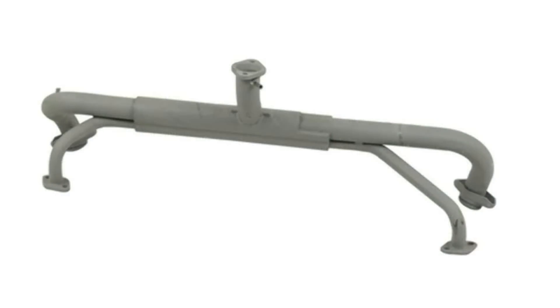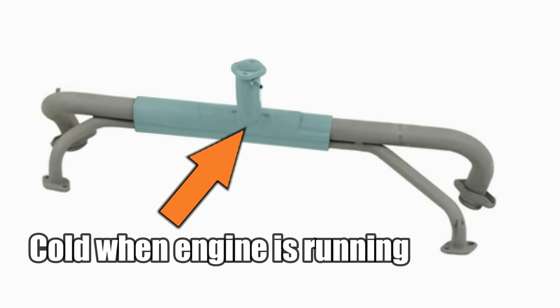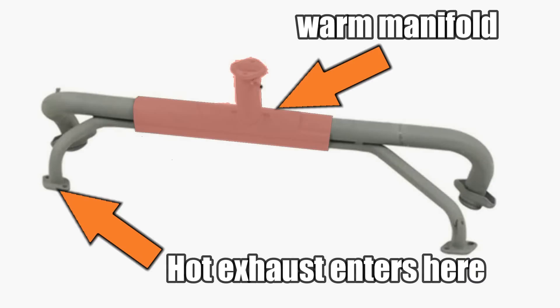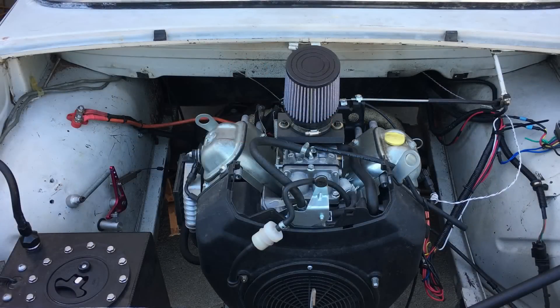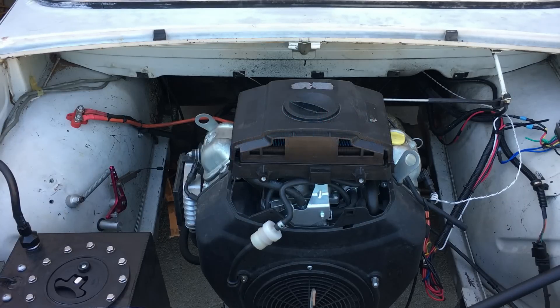Here's an example of an intake manifold used on an air-cooled Volkswagen engine back in the day. The carburetor sits here, and the air-fuel mixture travels down this manifold until it exits here and here. This smaller pipe is connected to the exhaust system, and it provides a modest amount of heat to the manifold. According to the hardcore VW community, on a VW air-cooled engine the intake manifold needs heat to help prevent the fuel from falling out of suspension before it's fed to the engine. If the fuel should fall out of suspension, the engine won't run as well and the fuel economy won't be as good. So that makes me wonder if the original air filter assembly and all the plastic covers are more than cosmetic — perhaps the covers keep the manifold warm. I don't know, but I bet we can find out.